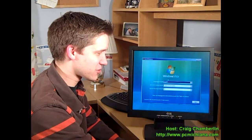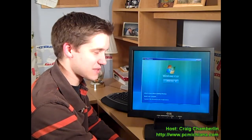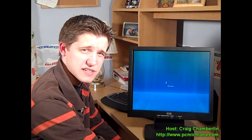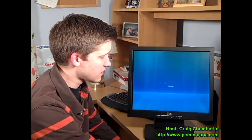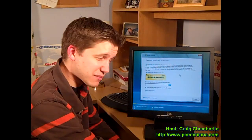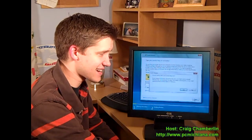It asked me what kind of keyboard I have — of course I selected English and a US keyboard, then clicked Next. Then I'm going to select Install Now. It says please wait while it sets up the installation files. It's going to ask me to enter my product key; I don't have mine on me, so I'll disable the automatically detect and activate option and select Next.